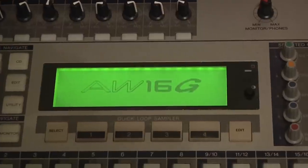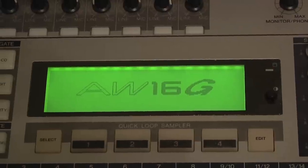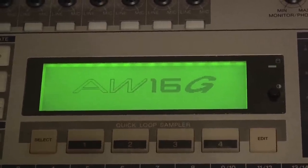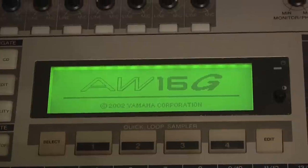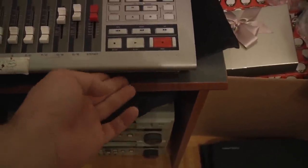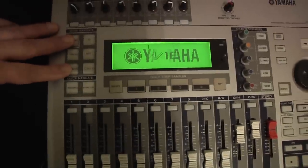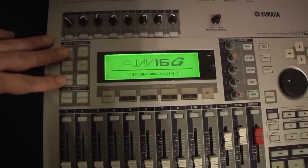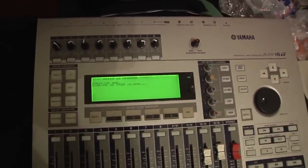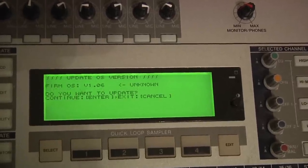Here is a little update at the end of the video. I purchased another hard drive — a brand new Hitachi 40 gig. I popped the drive in and it kept trying to boot off the drive, and I kept getting the boot screen just repeating and cycling. So what you want to do is pop in the operating system disk, and then when you turn the machine on, hold down the Song and Remote key. This bypasses the hard drive and boots directly off the system disk. After you do this, the rest of the steps are the same. So once again, thanks for watching and take care.